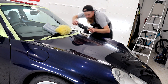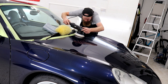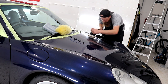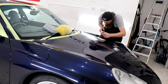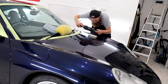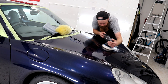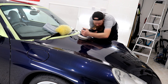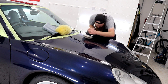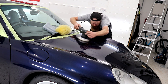Yeah, please. So typically with the refining stage, I'll go through three or four of each sized polishing pads. You don't want to burn these finishing pads out before moving to the next fresh one, but rather replace your pads when you need to, to ensure that those pads stay effective. A burnt out polishing pad becomes warped in shape and is no good for polishing to a professional standard. I'd much rather go through more pads on each vehicle and perhaps use, let's say, 50% of each pad's life before giving them a wash and then using the other 50% of its life on the next vehicle.